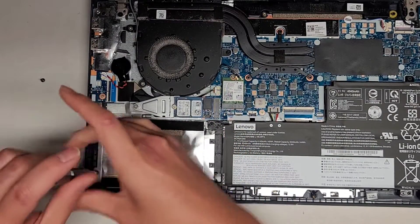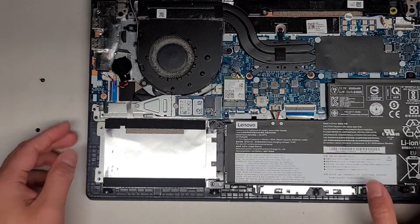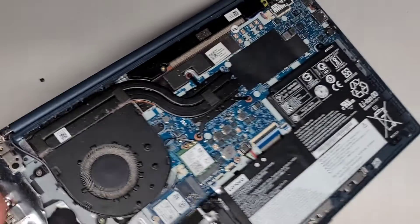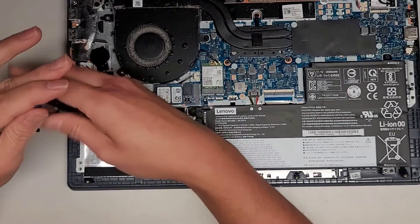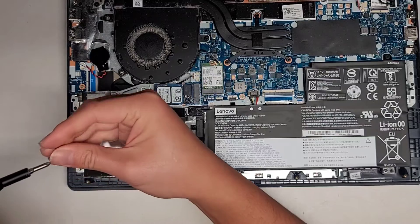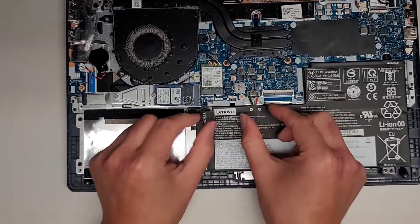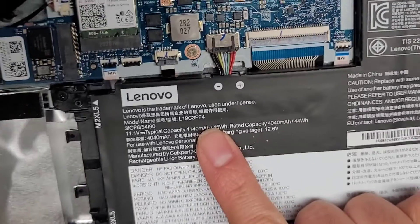Let's go ahead and take these screws out and take a look. They also hide two screws underneath the battery, so if you need to take the hard drive bracket out, you do have to remove the battery. I'm not seeing the screws for the hard drive — if you get a 2.5-inch SATA hard drive, keep in mind you're probably going to need screws to hold it into this hard drive caddy or bracket. The battery cable is pretty short, so you take all the screws out, then lift the battery slightly and wiggle the connector as you pull the battery.